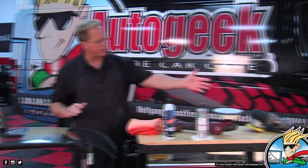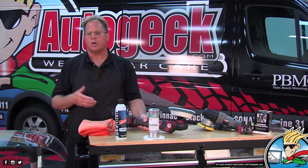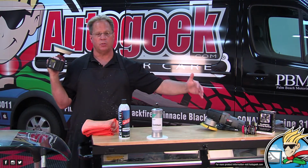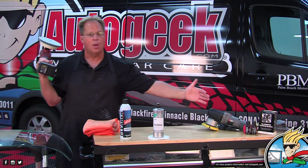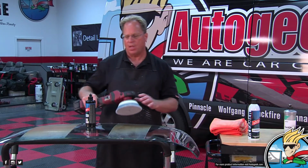If you look over here, Yancy, I've got a Porter Cable. You can use a Porter Cable. In my world, this is one of the weakest tools there is on the market today. It's a great tool. It's a tank of a tool, but it's also an 8mm free spinning tool, and it's a bit on the anemic side. It was good really back in the day, but it will get the job done. It's just going to take longer. So the fastest way is with a rotary, but you could use any polisher.